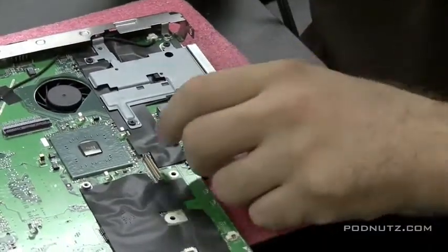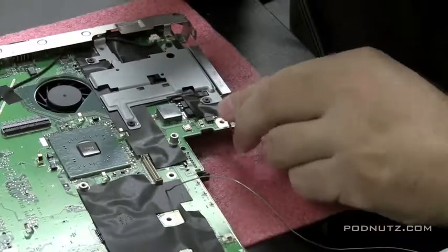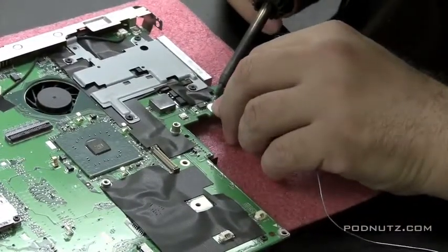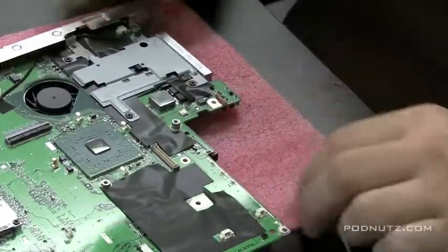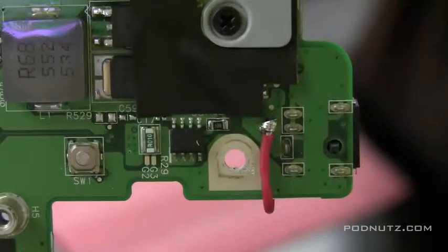I soldered that wire to the back of the power jack, bent it around the underside of the motherboard, and now I'm going to solder it to the point we filed on the underside. I'm putting a little drop of solder on that point, then taking the wire — which already has solder on the end from the helping hands step — and melting it onto the motherboard contact. That point on the motherboard must be the exact spot where the pin from the power jack originally connects; you can't just connect it to any random spot. You can tell it's the correct contact point by the light green color.